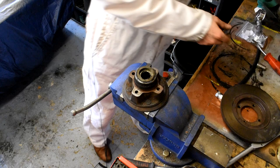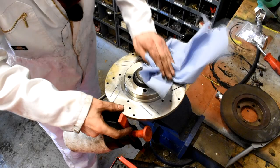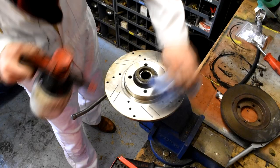Then the new disc, we just put it down there for now, and I'm going to clean up the front surface here with a bit of brake cleaner. We're just getting rid of any of the old grease that they put on these discs from new. It's really important to do this because you don't want any grease on your brake pads when you first go to brake. So just clean those up nicely,